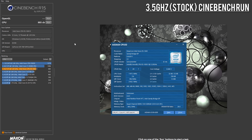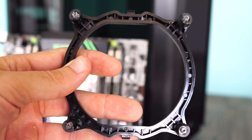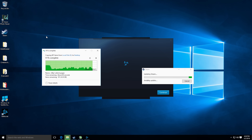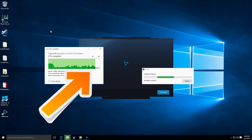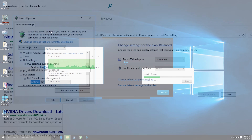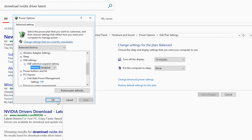Other things with this motherboard: you get two SATA cables included and the faceplate — and I will say these are some of the shortest SATA cables I've seen in my life. Also, if you are tuning this thing, make sure you turn off USB Selective Suspend in the power options. I noticed when it turns off the USB ports and then you go to turn them back on again, you get this very weird stuttering problem. When I was transferring files, the files were coming to a pause as well — so really turn that setting off. You may even want to turn off the PCIe Power Link setting as well, just to get smooth performance.